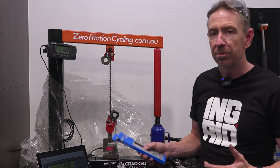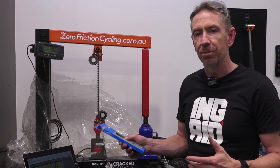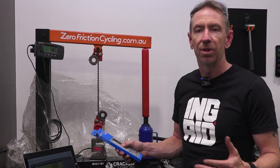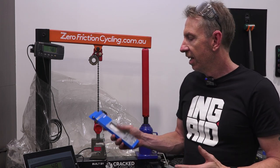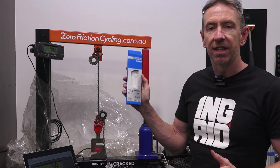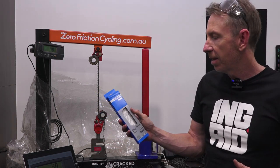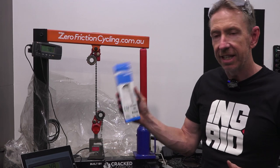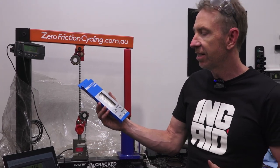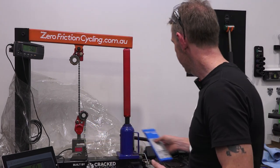12 speed, if you're on 12 speed, Shimano e-bike, their 12 speed chains have around double the durability in terms of wear versus Dura-Ace 11. So the XTR 12, XT 12s are a brilliant chain. I have wear tested this. I haven't had a chance to put that up on the website yet. This did come out at about 50% longer wear versus their Ultegra. So that is great. That is giving some credence towards the claim that the Link Glide chains are more wear durable than their normal 10 or 11 speed chains.